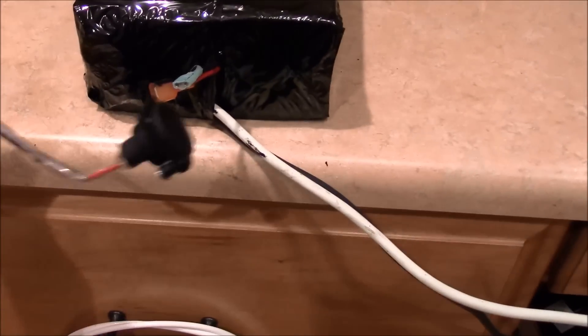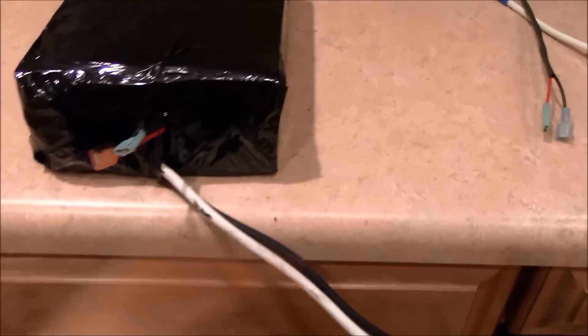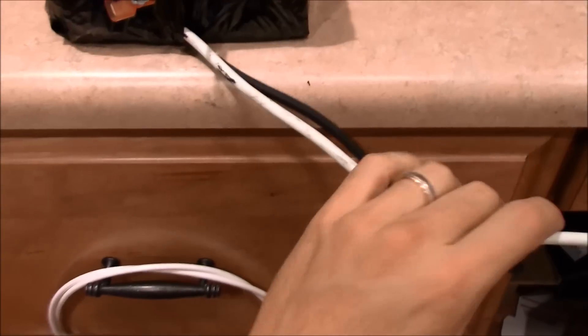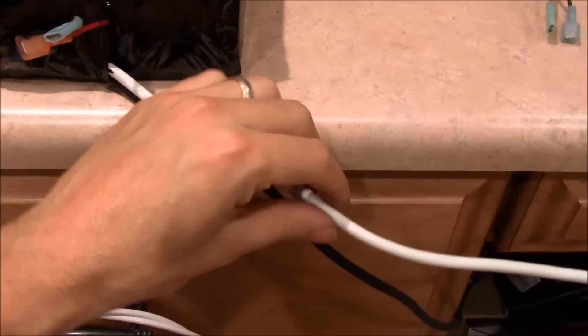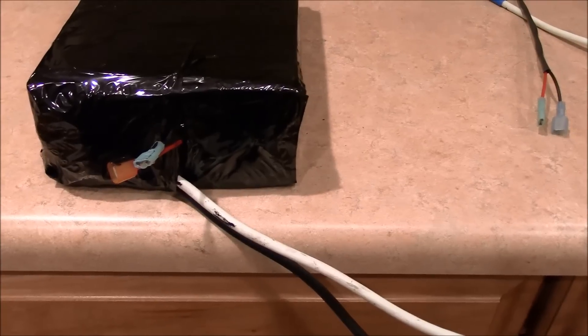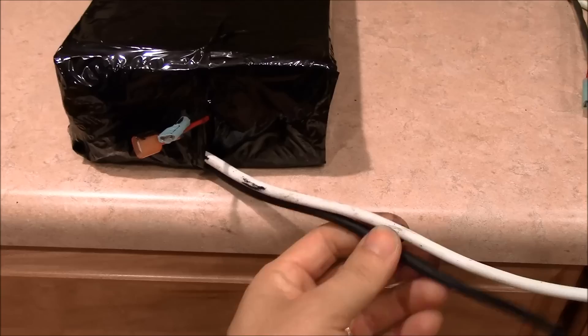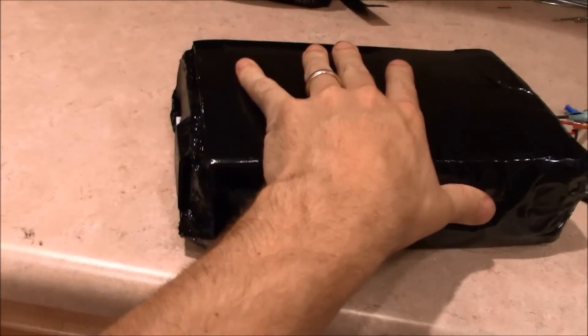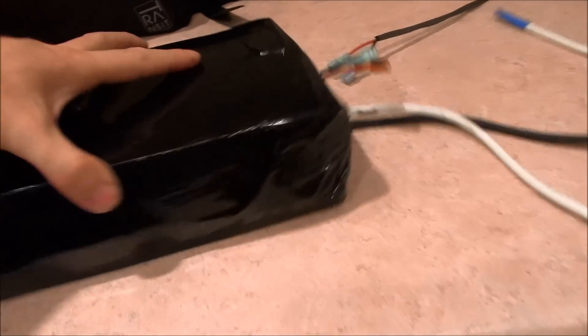So this is the side where the wires come out — I've got my charging port here, the charging wires, and then this is my port. I'll probably keep it plugged in all the time anyway. I've got the main bus wires right here that are going to go to my controller. It's pretty thick stuff — I think it's like eight gauge. What I may do is step it down to twelve gauge just before the controller to minimize loss and heat. So yeah, that's pretty much it for now. If you guys have any comments let me know, and if I need to revise anything I'll be glad to — thanks.